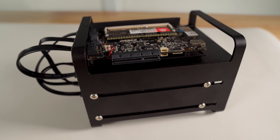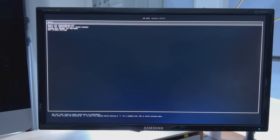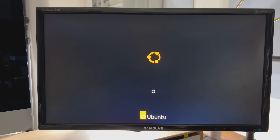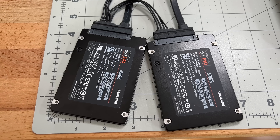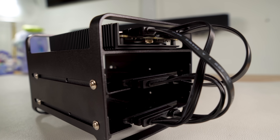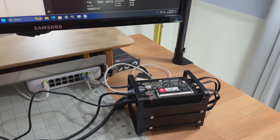Or, do what I did and create a dual boot Windows and Linux system. I use both Windows and Linux on my workbench and I always find myself toggling back and forth when testing hardware. When I saw that the Zima Blade had a case for 2 additional drives, I grabbed a few old SSDs, picked up a couple of cheap 3.5 to 2.5-inch drive adapters, installed the drives, and connected them with this Y SATA splitter.